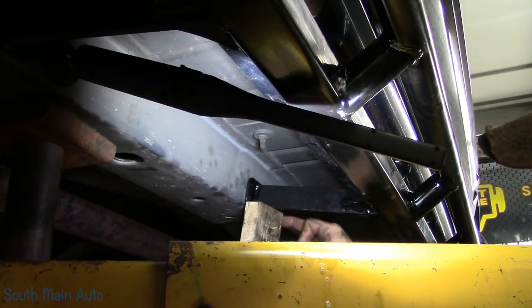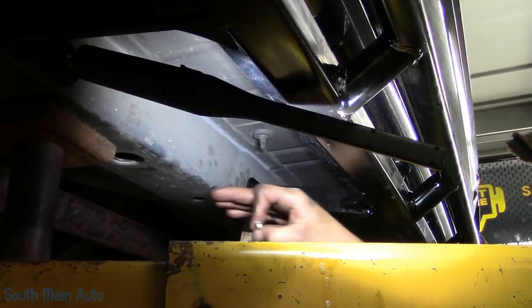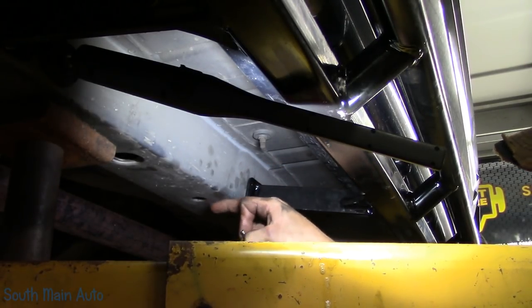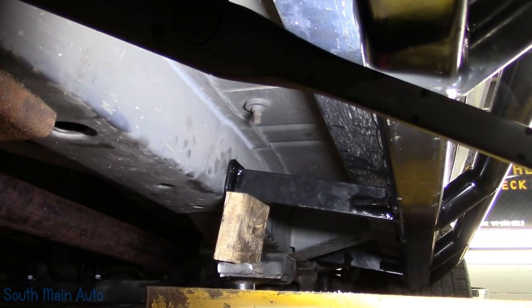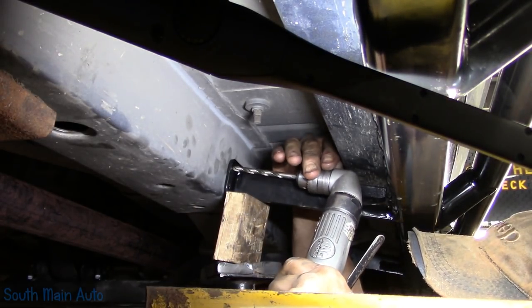So I'm going to keep this here, go through, punch these holes, get this one tightened up. The other two are already up above the frame. This is the only one on the other side that I had to put flush with the bottom of the frame. The other two sit up maybe quarter inch, something like that. So I'm using a 17/64 drill bit. It's one size above quarter inch. It just makes it easier to fish them through the hole. And then I just use their holes as a guide.